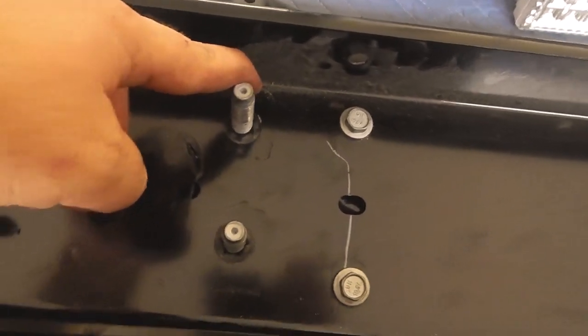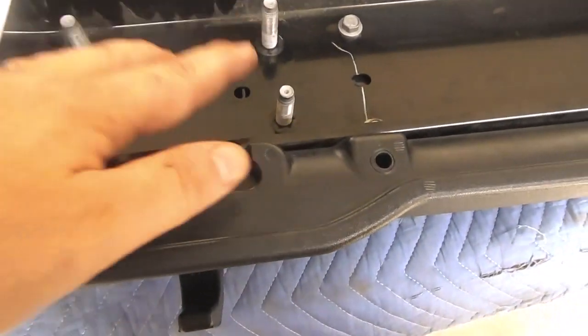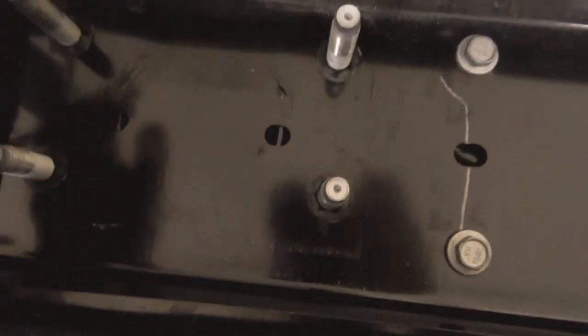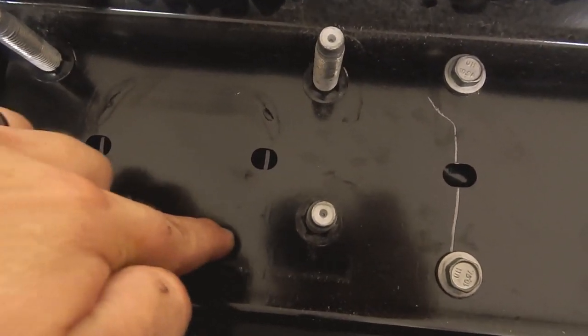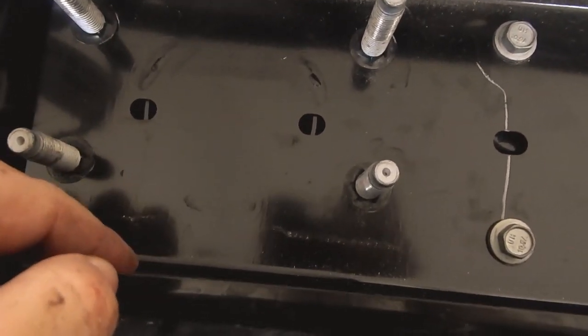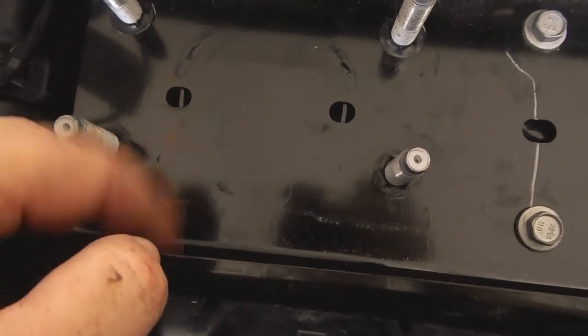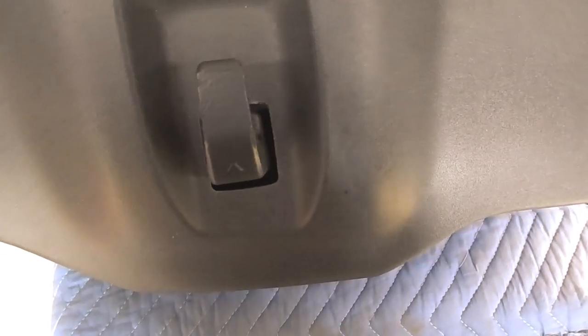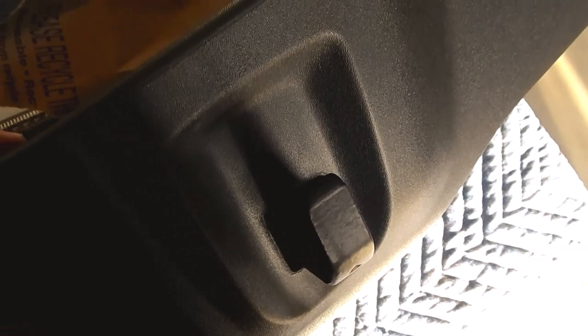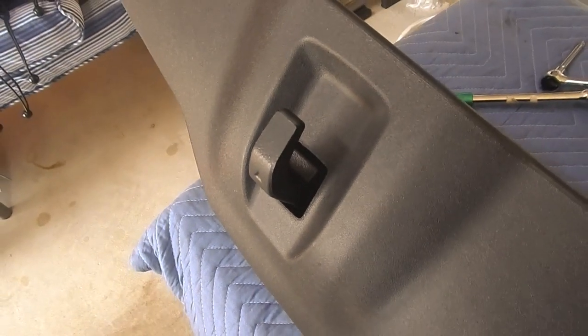This actually is the hook which bolts onto the frame. Then I thought initially, well, I'll just undo these lock washers and pull it out, but you can't, because you can see the round bracket that they've welded to this to keep the bumper from twisting. So next best thing, I'm going to mask the crap out of this and paint them with the bumper attached. So that's kind of the only way to do it. So we'll see how it turns out.